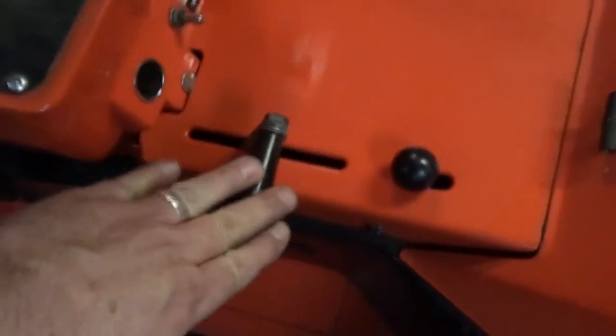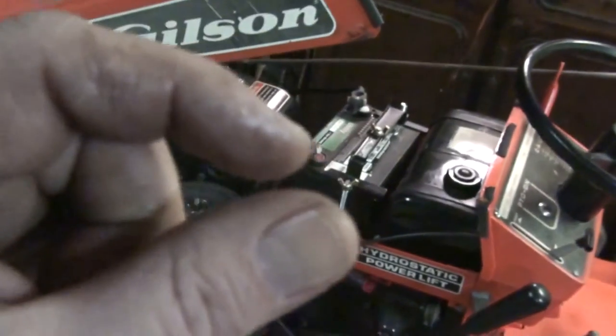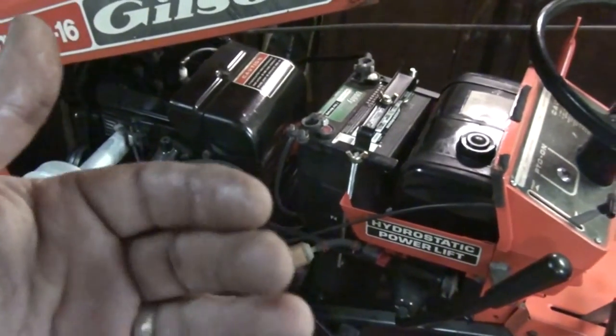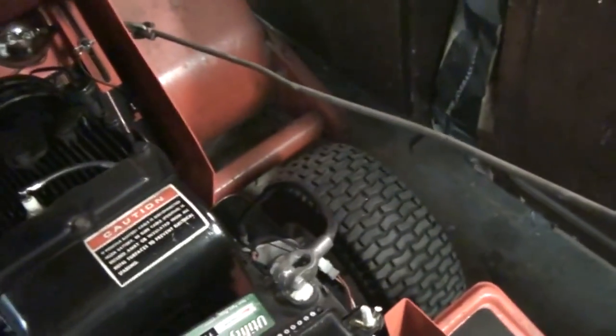I think that'll do it - when the brake came off, there we go. Yeah, I think that'll do it. Just needed a tiny bit more distance away from the flywheel and it's now not hanging up when it recoils. It was actually doing that several times without anything behind there, so I'm going to call that good.